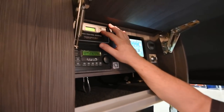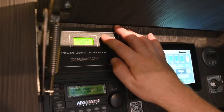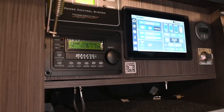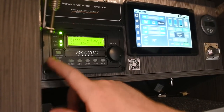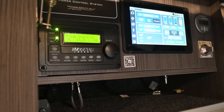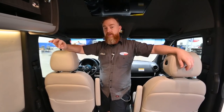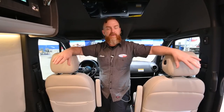On the top left, you've got your power control system — we're on 30 amp service. If you ever drop to 15 amp service, change the setting to 15 amps so you don't overload the unit, and always bump it back to 30 when plugged into standard 30 amp shore service. Below that is the inverter. The only button you'll interface with is the one on the bottom left to turn the inverter on — note you need to press it twice, as the first press just turns the display backlight on. The inverter provides AC service when you're boondocking and can't use the generator, powering the televisions and any plug-in devices. Do not ever turn the inverter on when the generator is running — the generator will overload the inverter and you'll have to turn both off and give them a few minutes to reset.